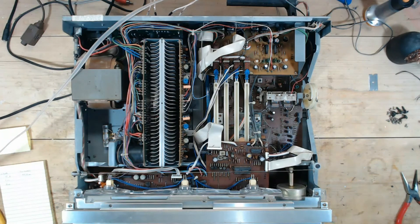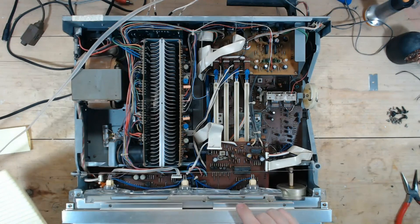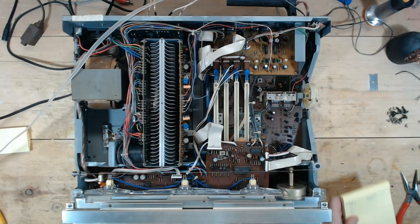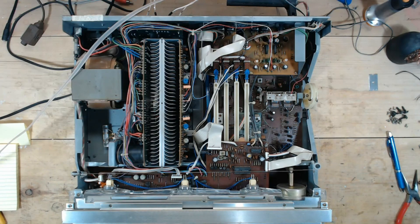Here's the inventory of what needs to be addressed: speaker A, FM auxiliary lamps, and then the bright and dim switch is broken, as is the FM muting switch. I'm going to tear the board out — I'll have to disassemble this thing after all, get to those variable resistors, and probably rebuild that amp board.